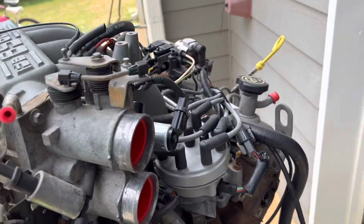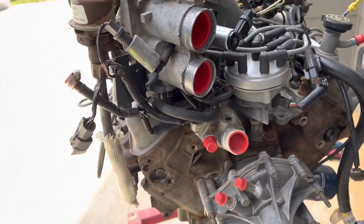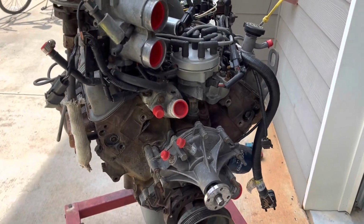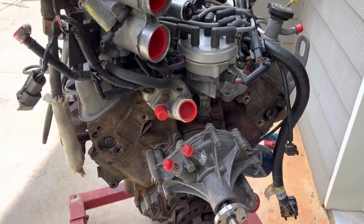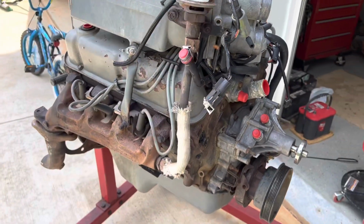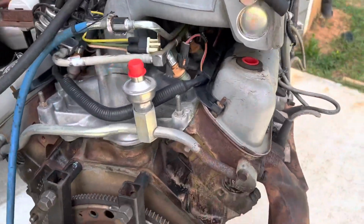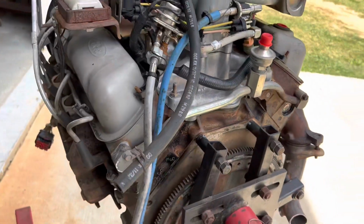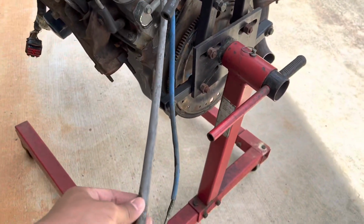So it's a hydraulic, I might just find me a mid to low 500 lift cam with a 112, 114 lobe separation. Slide that in, change the lifters, stay with hydraulic, and it all depends. When I open it up, it's either I'm gonna stay with hydraulic or I'm gonna retrofit it and go solid roller. But this is what it looks like from the junkyard. Pretty clean. Came with the flex plate, so pretty much it's ready to run, they said.